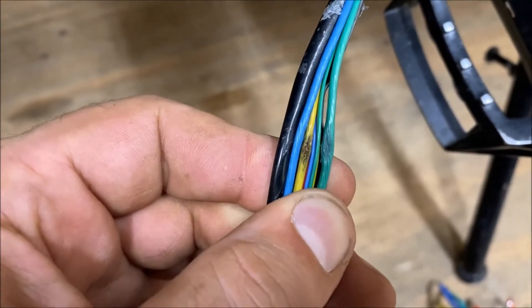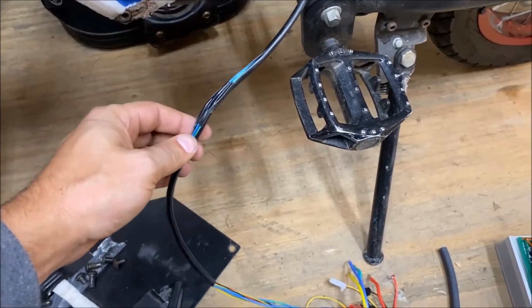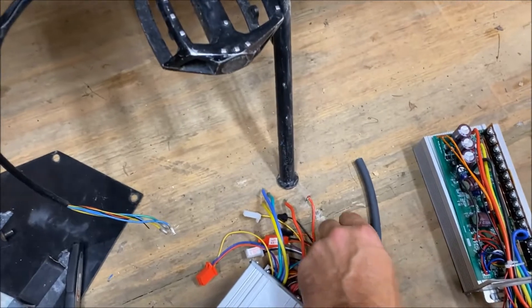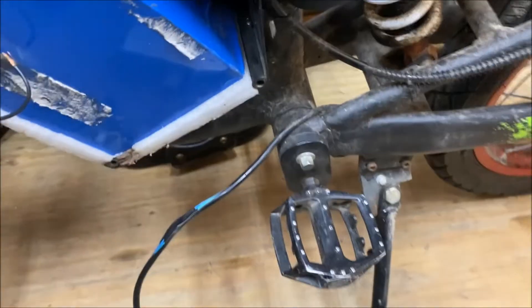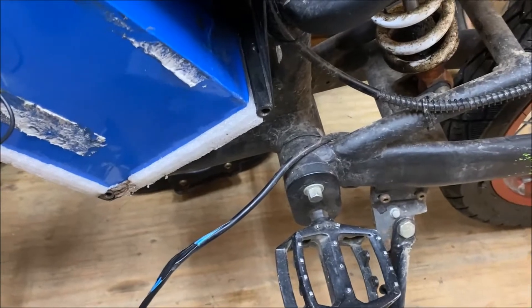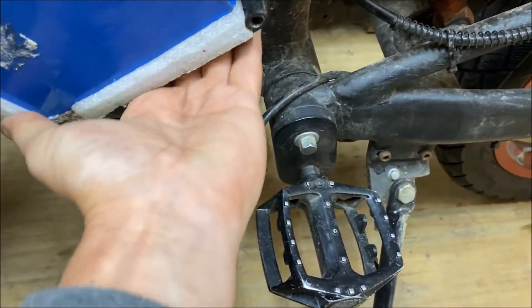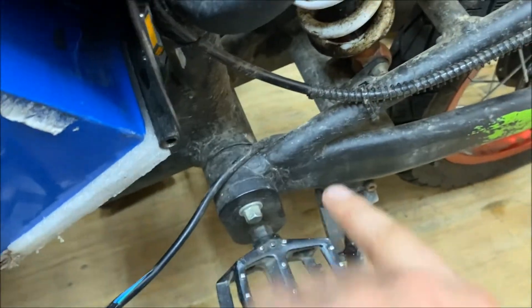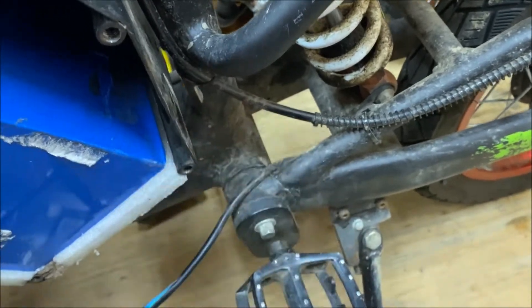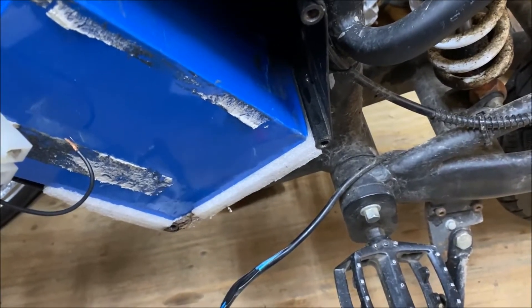I spread it apart and there's our short. I've repaired the cable — put some 3M 600-degree tape around it and insulated all three phases. Now I'm going to put a piece of heat shrink over that and shrink it down. I'm also going to drill a new hole inside this enclosure to route the battery wiring. The current hole is on the bottom, so the wire gets pinched by the battery. I'll make a new hole up in the top portion and put a rubber grommet in it — should be a little safer.